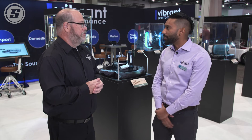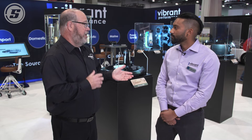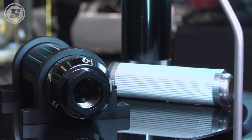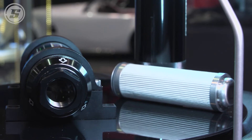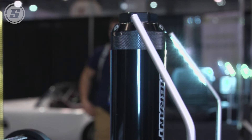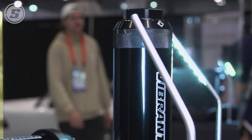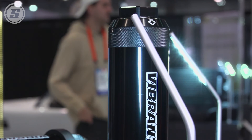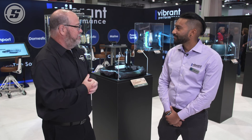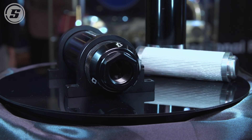For a lot of street applications, 40 is good. And this housing can be used as a pre- and post-filter. Oh yeah, and we even recommend doing staged filtration — that's also a really good option. So you might actually run a 100 micron pre-pump, and then post-pump you could do a 40 and a 10. That'll prevent your 10 from clogging up sooner. Kyle, I appreciate your time and learning all about Vibrant's new filter here and what various micron filter ratings are for.